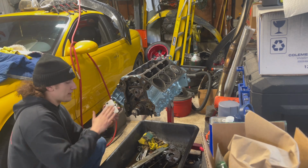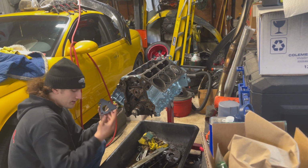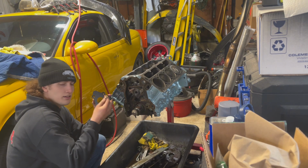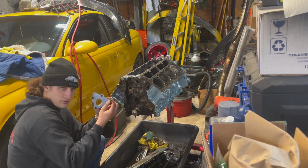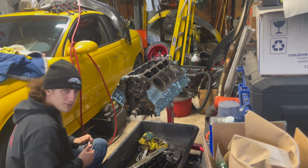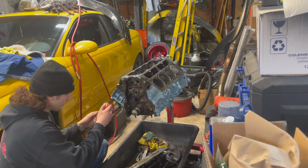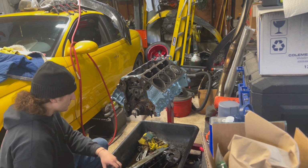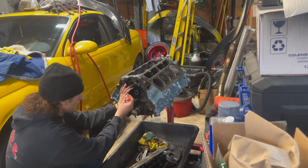The one on the LS1 was actually perfectly flat, so it had a normal traditional style shouldered bolt on it. The new one is actually beveled, so I'm going to be reusing the hardware off of the LQ4's original cam retainer plate because it's also beveled. So I've read and heard in some videos it's not required. I'm going to do a very small dab of Loctite on it, very, very small, just as a little bit of insurance. So now, throw that there.